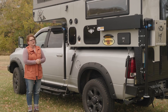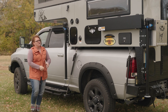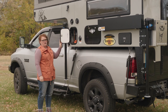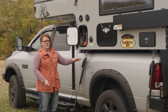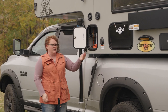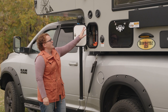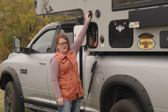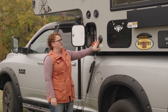On the driver's side of the unit, this is where a lot of the additional nuts and bolts are. In this front compartment, this is access to the Truma Combi — that combination water heater and furnace out of Germany that we use. The Combi is a standard feature on this unit. There is no interior shower, but with the water heat addition, we do get an outside shower at the back of the driver's side. We also have a gravity water fill — standard on everything for using potable water when you're out — as well as a 30-amp shore power hookup.